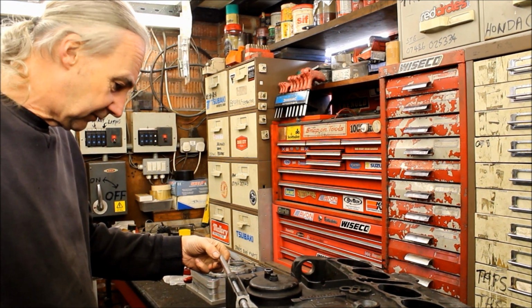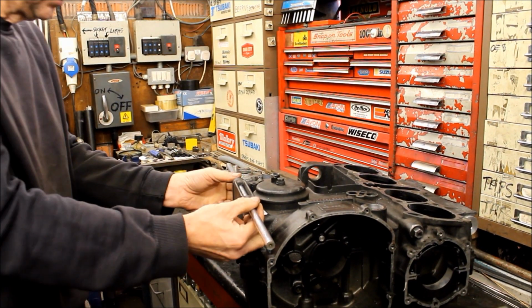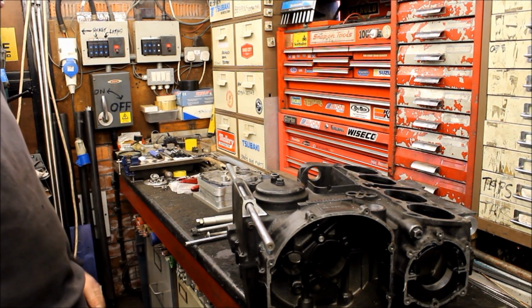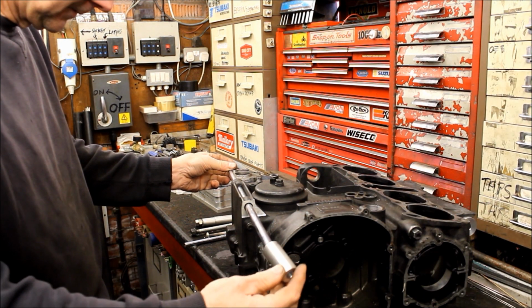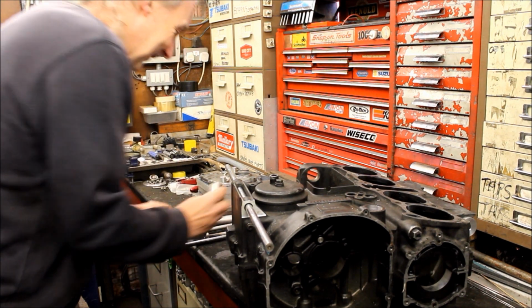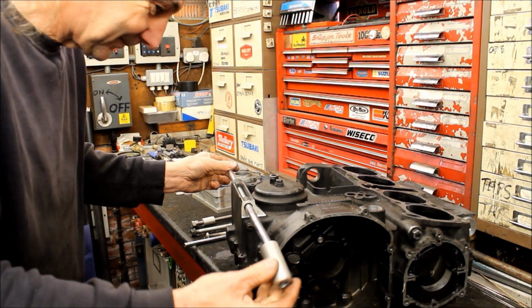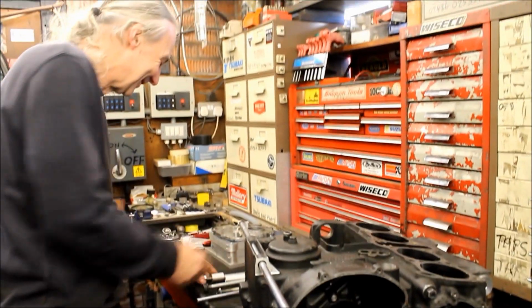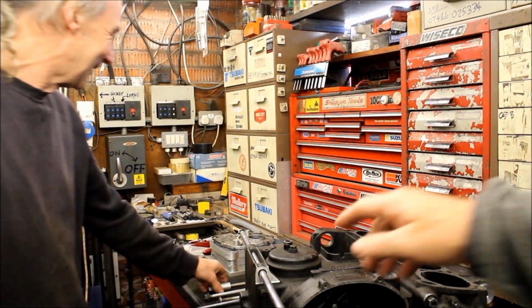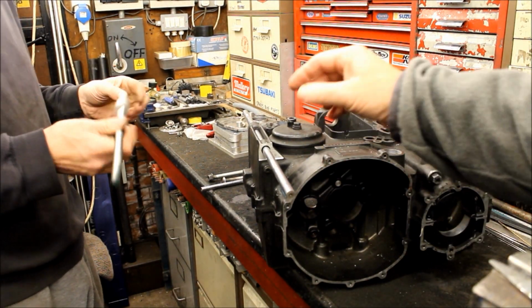There is a touch of it on it, but that's 12.7, so it's taken it out. Obviously that is a lot better in there. So now that bar is going to have to be threaded. But the spacer is still... they're the wrong ones, no, that's the one. Oh no, they're at 12 mil, so they want reaming out to half inch. Anyway, it will fit. This bar now just needs to be machined down. That is the length that we need.